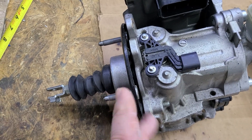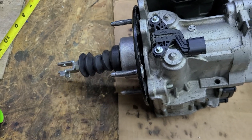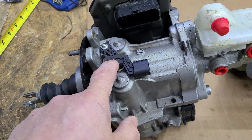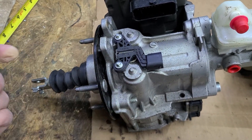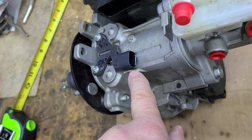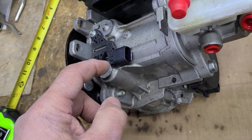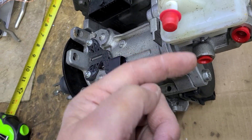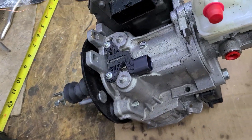The Teslas come with a different style plate — they actually come with an aluminum spacer, which makes it kind of weird to add on. How this lays out is this is essentially a pedal position sensor, similar to a throttle position sensor. So as you push in on the pedal, it changes the resistance on here. There are four pins inside of there — you've got ground, and five volts or 12, I can't remember which, and then two inversely proportional voltages that will come out, same as like a drive-by-wire on an LS1-style computer, or O3 on up.